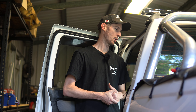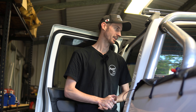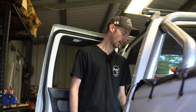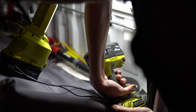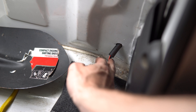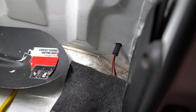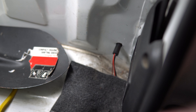I've gone ahead and traced the wires down the center console and over the little compartment, out of the way. I've also taken off the floor trim piece so I can lift the carpet up slightly — there's already factory wiring and harnesses running through there, so we'll just follow those. The center console is buttoned back up; I haven't put the screws back in yet just in case something doesn't work. Now it's just a matter of tracing the wires out the back along through the carpet.